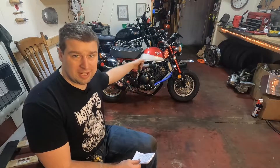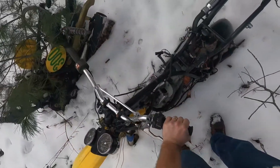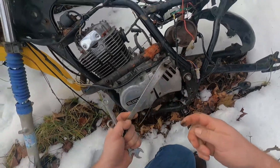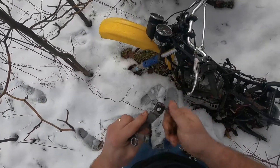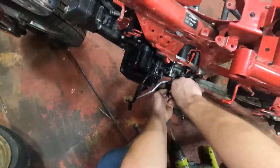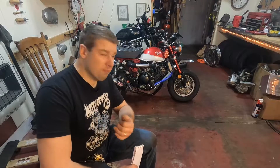To get the mounts set up for your foot pegs — your brake and your shifter — the stock shifter just doesn't work. I went out to my parts yard and pulled a shifter off a 1981 Suzuki GN400. You could also go on eBay and buy one. It's the same length you need, though you'll have to bend it to fit. You have to open up the spline adapter a little because it's narrower than what's on the CBR — you drill it out for a bit more clearance, fit your bolt through, then bend it to spec, slide it onto the shifter, and it works great. I have a shifter that cost me nothing from a parts bike.